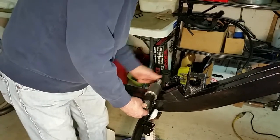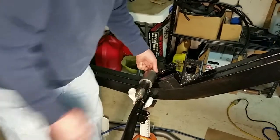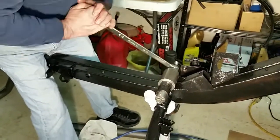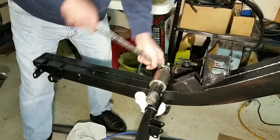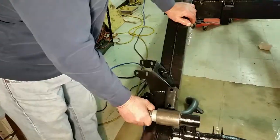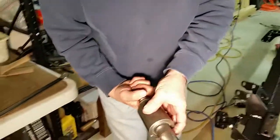You can see that pulling out. A nice long wrench in case it's tight. You can see the puller disappearing into the chassis. It's a pretty good pull, but it's a coarse thread and going in fairly quick. So we've pulled the bushing out — see the bushing is there, see how well it came out.